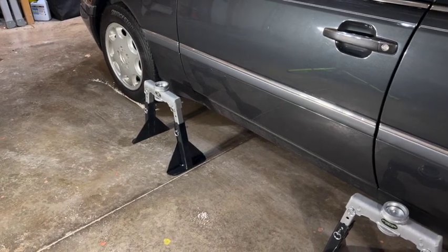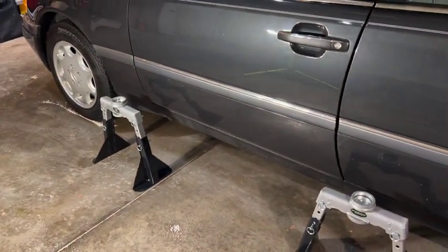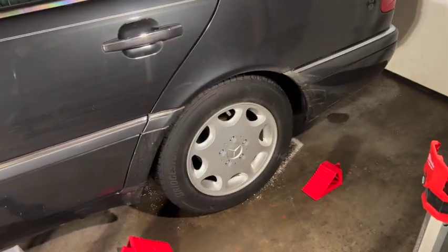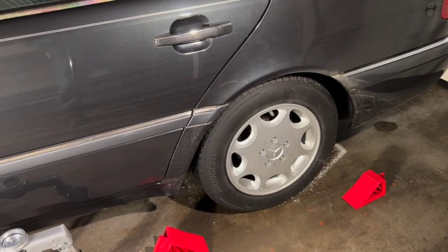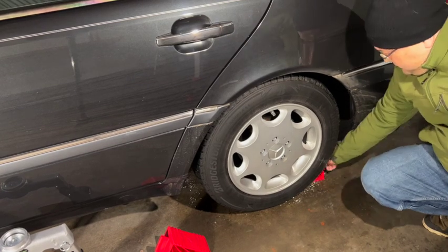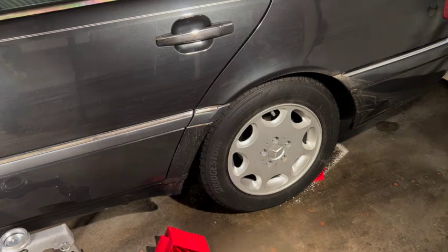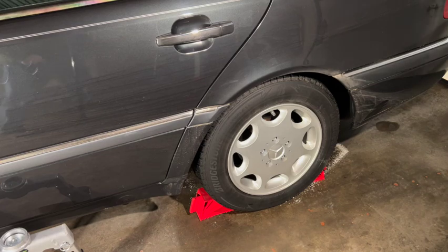If you're using two jacks, lower the jack completely and get it out of the way before you raise it on the other end, because you don't want the car to suddenly get supported by the jack — that creates an unstable environment. The next thing you've got to do is put wheel chocks underneath your tires. If you don't have a pair, make sure you get a pair. Put them underneath the center of the tire — that's just an added safety. I've got another pair on the other side for good measure. Now we are going to begin the lifting process.